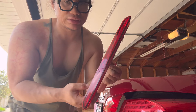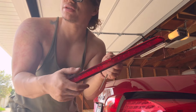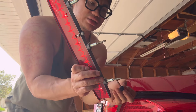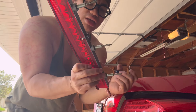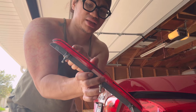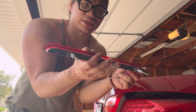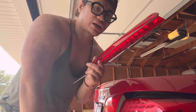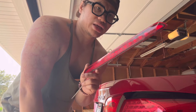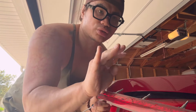I can guarantee this light replacement is probably like five hundred dollars — you know how BMW prices are. To get it off, all you have to do is unbolt it with an eight millimeter. If you want to prevent cracking the lens, you probably want to heat up the adhesive before prying it off — don't do what I did. But yeah, that's the last thing I'm going to take off for the body guy. I'll probably wipe down the car quick and then we're going to drop the car off tomorrow. I'll see you guys in part four!